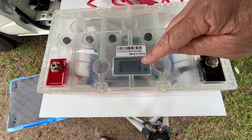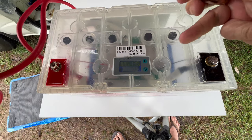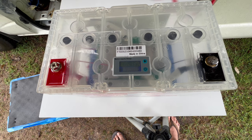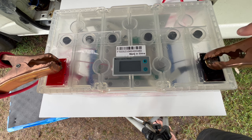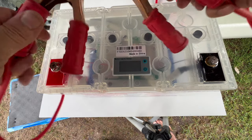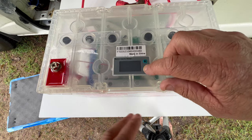I will now short this out to make it go to sleep. So I've got a jumper lead and I'm going to short this out and knock the BMS out so it goes to sleep. You're driving along and you have developed a short in your battery. I've shorted it out and as you can see there, it is absolutely dead.